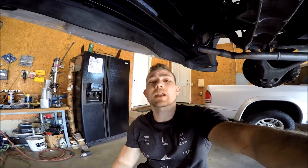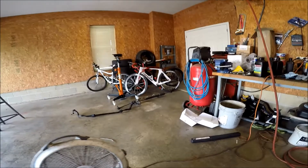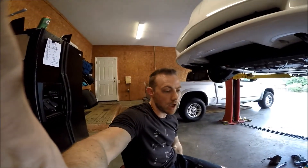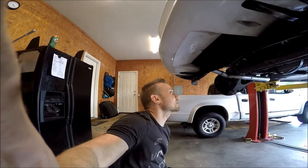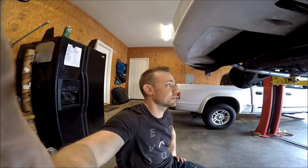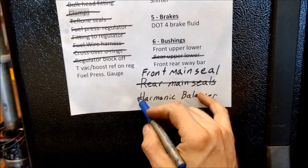I've got it at 200 foot-pounds, and I don't have a supercharger, so I'm not worried about that. Now it's just getting all those goodies back together — getting the steering rack back in there. I ended up having to take the sway bar out because it was just in the way. Now I'm going to put the rack back in and put everything back together. It's pretty much just the reverse of what I had, so I'm not going to video that. Harmonic balancer — done.